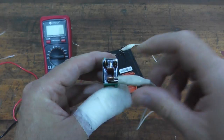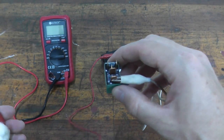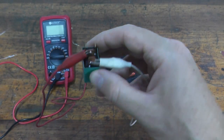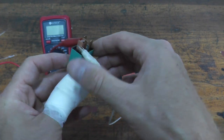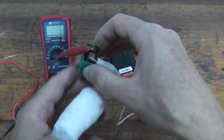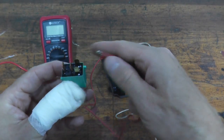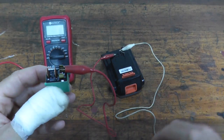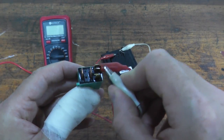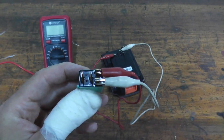If you power it up, you should hear a clicking noise — that's a very good sign. However, if nothing happens, try the other series. This is a modern relay pulled from a 2006 Acura, and unlike older relays, it has no schematic showing how it's powered up. So we use process of elimination. Placing the leads on the vertical terminals — there we go. Just process of elimination.